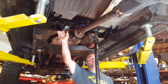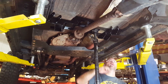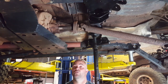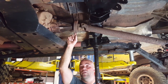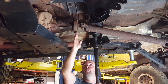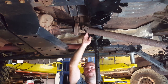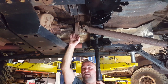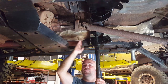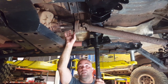We've got our subframe in position. To center it up, you just eyeball it — there's a hole in the subframe and a hole in the Jeep and you just line them up. If you have the 242HD transfer case — the heavy duty 242 with the 32-spline output — the output is a lot longer, which moves the harmonic balancer back a couple inches and could cause interference with the subframe. The best option is to get a new driveshaft without the harmonic balancer. We do make a hack-and-tap for that transfer case so you can use a double-cardan CV — you just cut the end of your shaft off, tap it, and put on a new yoke and a new double-cardan CV driveshaft.